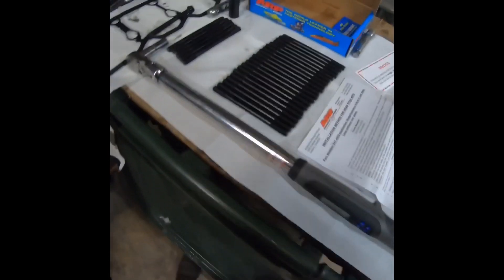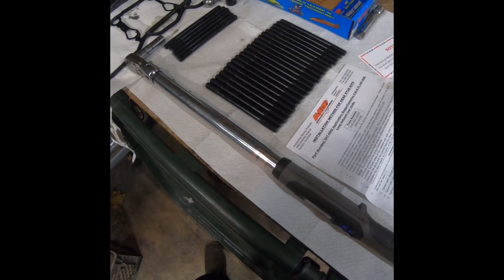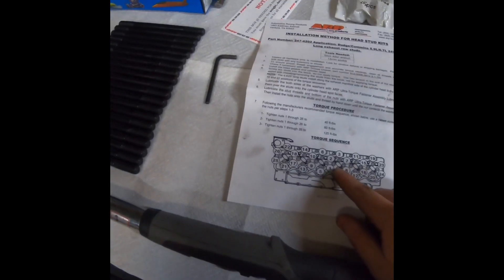What is going on guys, me and Mason are finally in the garage. We got some parts and we're ready to start working on this truck and get some stuff knocked out. We got the ARP head studs in — they are the ARP 2000s, the cheapest ones you can get, but they'll be plenty for what this truck needs. To do this I'm just gonna get right to it. It gives you a pattern — we're gonna do the one-by-one method so you do not have to remove the cylinder head.